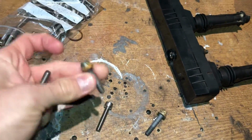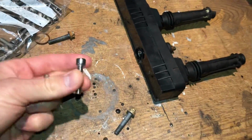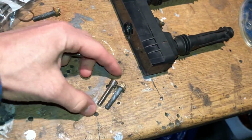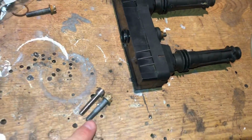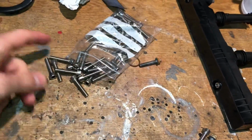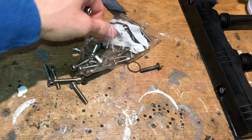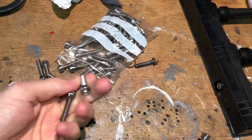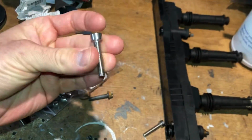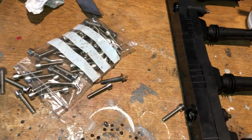It doesn't matter if you buy brand new ones like these were, they still rust as soon as they get some moisture on them. If you want to know, these are M6 by 30mm, so the thread, you can see, is perfect for the stock size bolt. Fits in the rocker cover nicely, so don't go out and get yourself ripped off by eBay bolt kits or whatever. I think I bought 50 for about £3, and you only need 10 for the rocker cover. So as I say, M6 by 30mm stainless bolts do the job, look a lot prettier and don't rust.